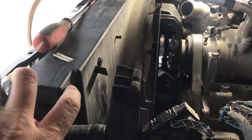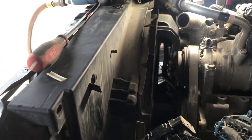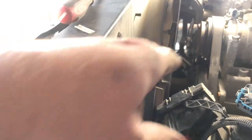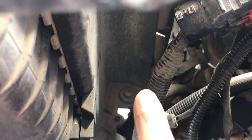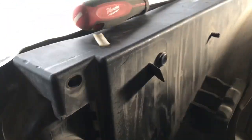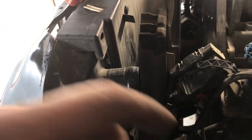Now, the fan shroud cover — or radiator cover — is held on with all these plastic clips everywhere, all the way going down. You can't see that one because it's too dark, but there are two of them there, and then here and here. I already pulled that one out, same with the other side. Then the top of the radiator cover should come off, and we should be able to see the fan shroud to see what it takes to get that out of there.